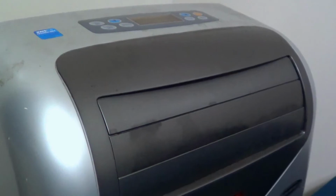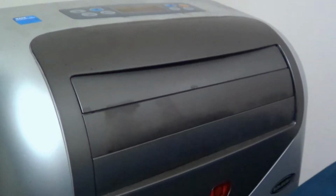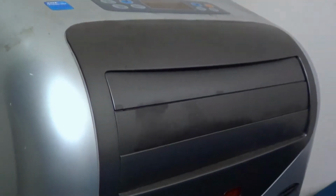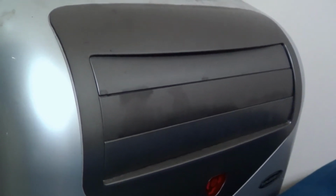This turned out to be useless as an air conditioner, not because it wasn't very good at it, it was extremely good, because it's actually a 2-hose one. You can see hose number 2 back there. But unfortunately, the Soleus Air was the subject of a class action lawsuit because the air conditioner component was advertised as being self-evaporating and never needing to be emptied out, like a humidifier or something. Unfortunately, due to the design, if your floor wasn't completely level, there was a very good chance that these damn things would leak. Portable air conditioners suck. Bottom line, don't buy them unless you absolutely have to.